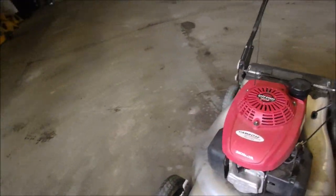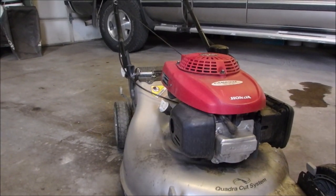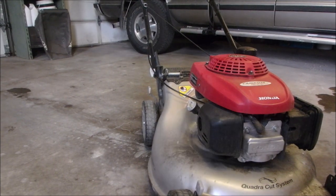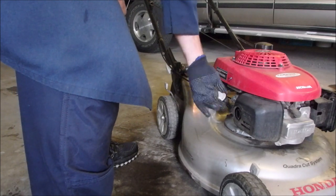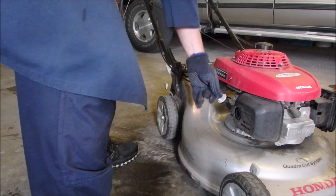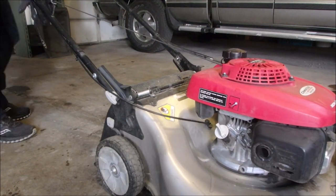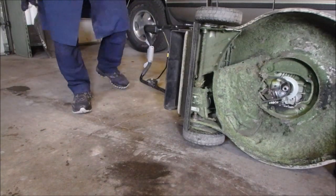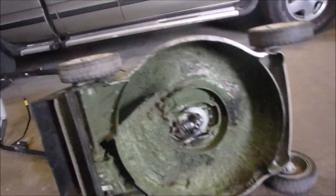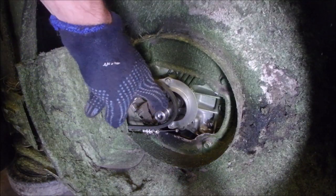The first thing I'm going to do is take the oil out of this guy. I've already drained the fuel out. Then we can work on it sideways, upside down, or whatever we want. We'll put the dipstick back in here, bring the knee pads down, and see what we can do. When I measured this crankshaft, it was three-eighths of an inch out.